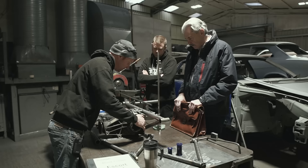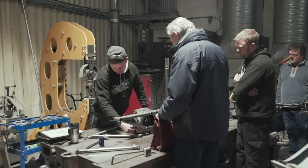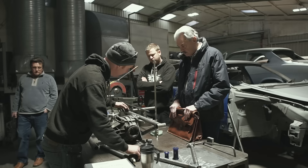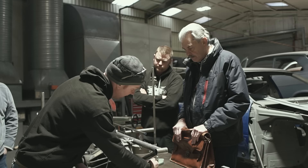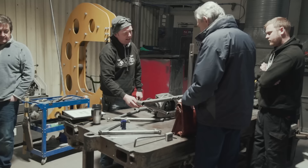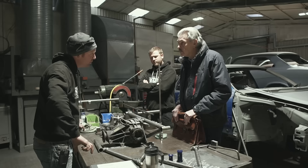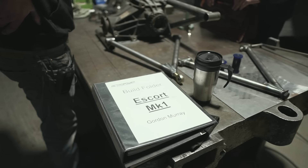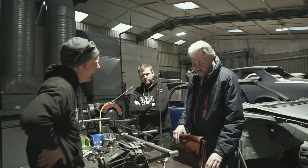Positionally it's all the same - that's just a laser-cut blank of the CAD piece that will be done in aluminium. There'll actually be a 50mm thick boss off there which carries half of the wishbone. This frame will sit further back because the aluminium disc cover will space all that back. The tube will be in the same plane as the bush housing, and the double shear for that bush housing will come off a tab off that frame. The front leg - that's the bit that's still not done yet - will basically be a tube that comes across, curves slightly forward, and picks up off two more bushes onto the inside of the chassis. The only question I had was whether to put any tie between the front and rear of the wishbone. I see everybody does tie front to rear, and I figure the flex in the bushes means maybe I ought to put a tie in.